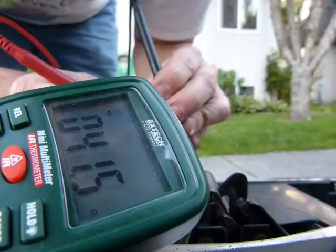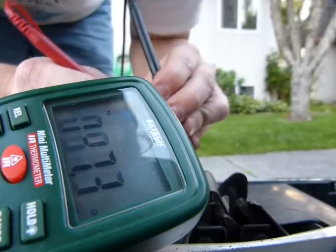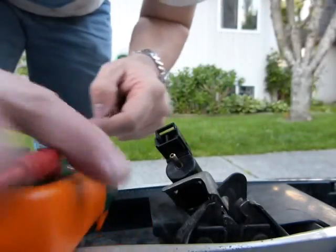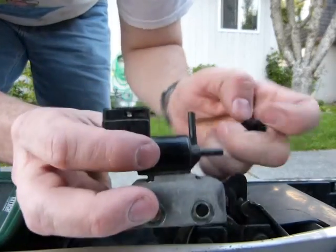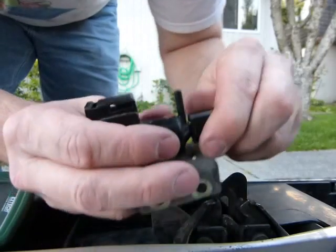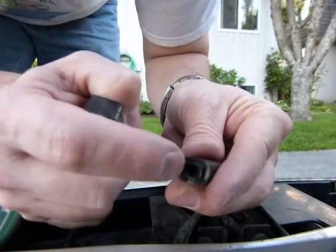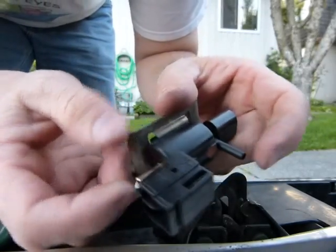You can barely hear it — it's such a faint audible signal that it's barely even anything. It works fine this way but it's really poor the other way. There should be vacuum between some of these ports. This is port A, from which I just took off the square unit, port B, and port C. I'm gonna check it with a hand vacuum pump. It really does come off this easily — it sucks in air through the square openings, that's the intake, and transfers it to the round side. The engine is sucking air through both of these.